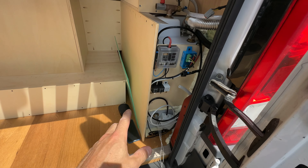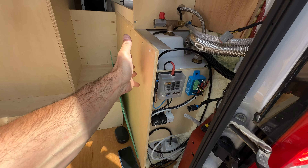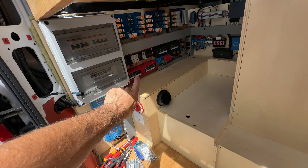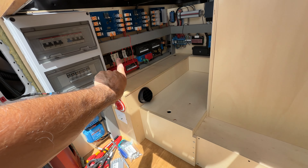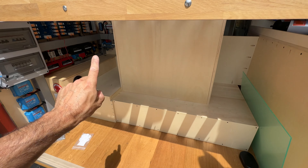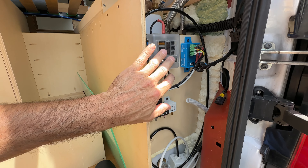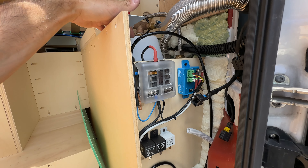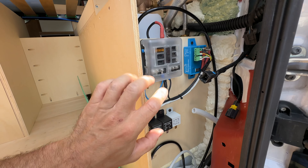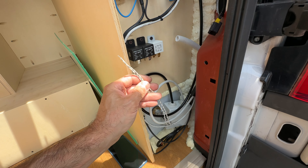I finished — not really finished but almost done — the electrical system for the water tank. I have a secondary fuse box coming straight from the bus bar with a fuse and another battery protect on this line so the BMS can turn off this section of the electrical system. So far nothing is connected beside the water pump that was already there. I'm going to add just a switch for the water pump, and what's missing is connecting the heating element for the winter.